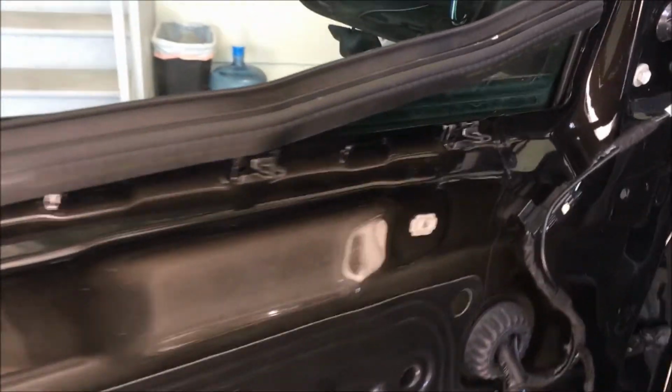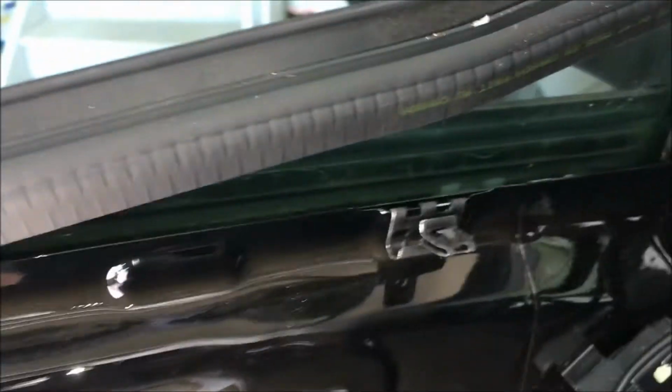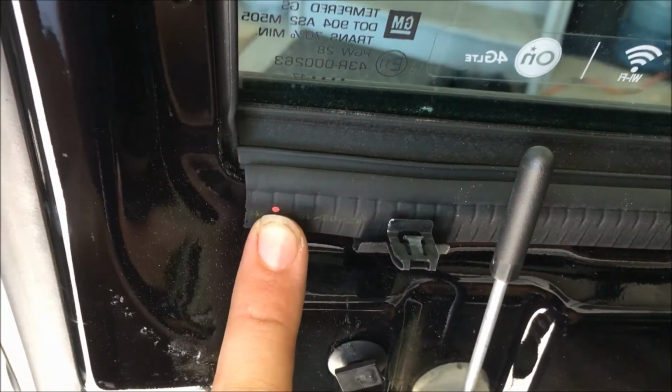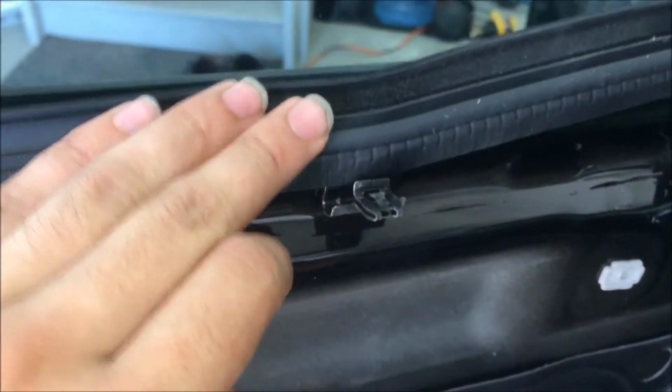All right, guys, just wanted to explain what we did here. Pulled the clips from the door panel itself. They go back into these slots. There are 5 of them. Then you're going to put in the weather protectant seal. Orange dot is out to the left of the door. So you're gonna slide it in between, pushing down on each one of them.